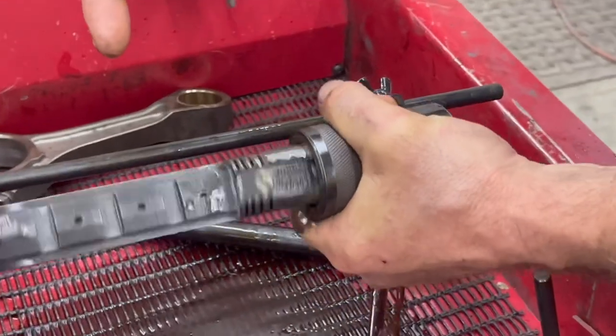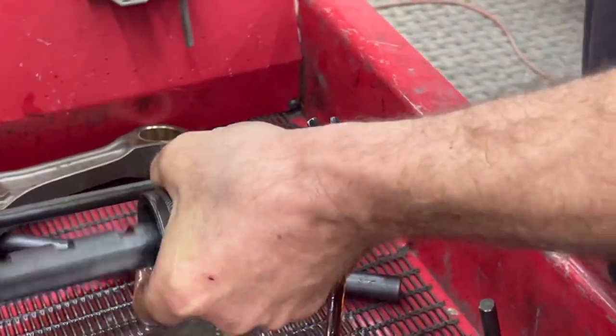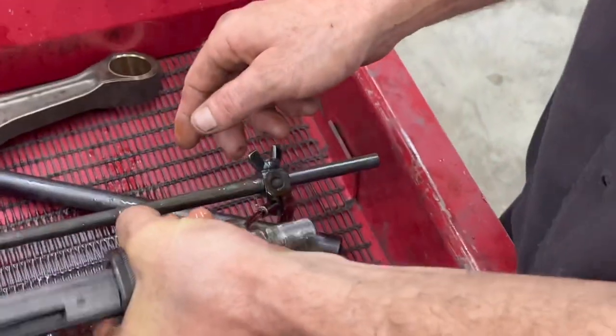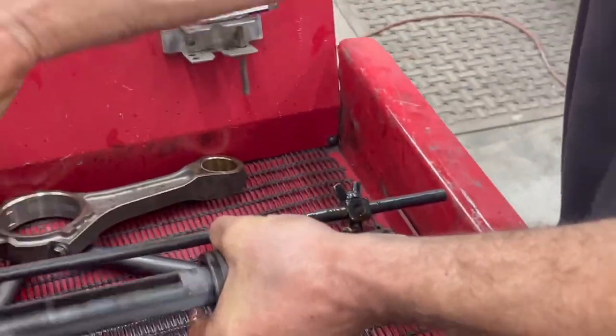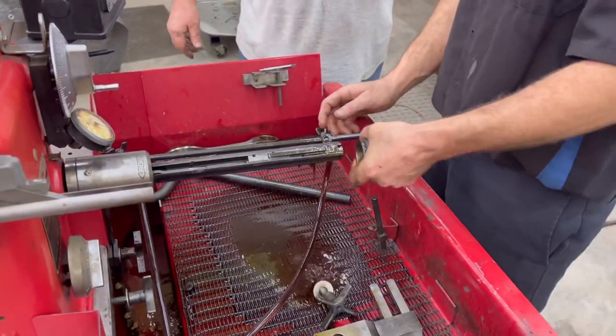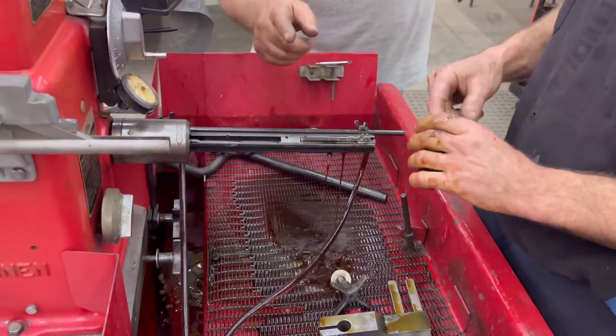You want to overstroke, on this one, probably about 3/8 to a half inch. Oh, I'm going way too far. About there. Yeah, you got it. Should I back off a little bit before I stop? I think you're done. Just stop it. It'll come off. Now you're ready to put a rod on, except you got to back it off a little bit when you do a rod.